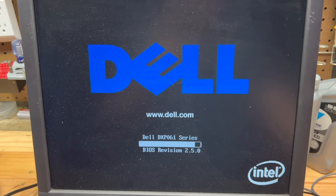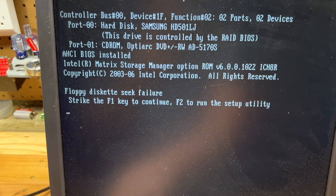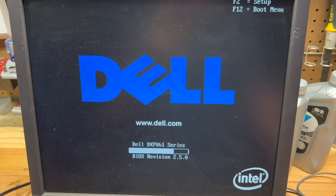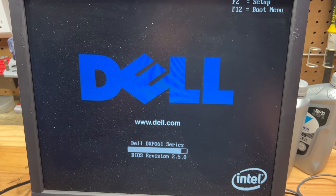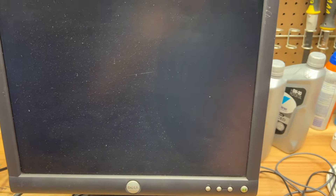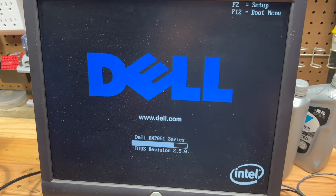VGA, date and time — yeah, 2007. The clock battery must be bad; we can replace that. We'll set the date and time for now. Oh, it has Windows 7! That wasn't good — it rebooted. Start normally. It keeps rebooting. We'll have to look into it.